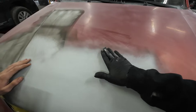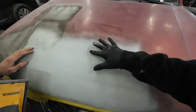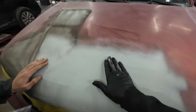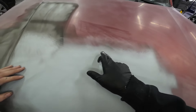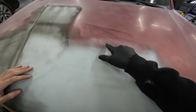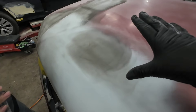There's a dent or a wave right here. Feel over this area — see if you feel that. So that could be a crown right here, or it could be a low on the other side of it. What I want you to do is block over this area right here, and we'll block it in all different directions so we can see what we have.